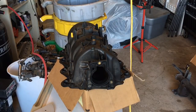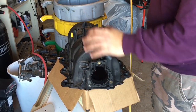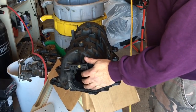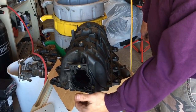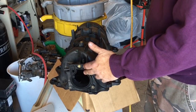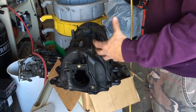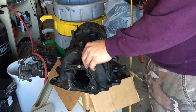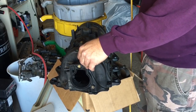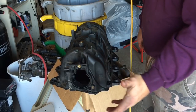I don't know if you guys are familiar with these, but they have the outer shell, and if you'll look at it, it's got super long runners from the entry of the plenum to where the air actually gets to the head. It's really super long, it's supposed to be really good. I think they said 7 to 10 horsepower at the tire, and similar torque in the usable RPM ranges.